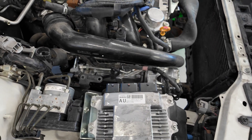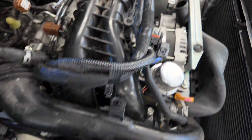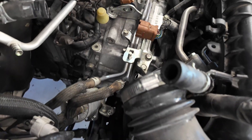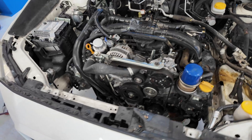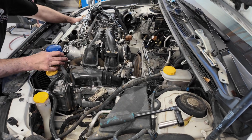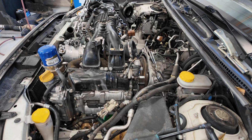After a little bit of work, we've got the radiator removed, the air conditioning refrigerant recovered and disconnected, fuel hoses disconnected, fuel lines disconnected, electrical harness disconnected, starter disconnected, bell housing bolts all out, torque converter bolts out — they go in this hole by the way. Pretty much everything around the perimeter of the car has been disconnected. Now it's time to connect the engine hoist and remove the engine. Be sure you've got clearance on the hood. We're now separated from the torque converter and the engine is ready to come out of the engine bay.